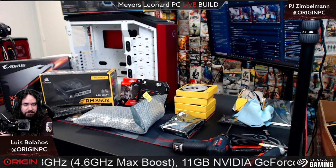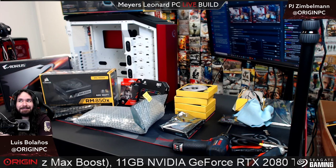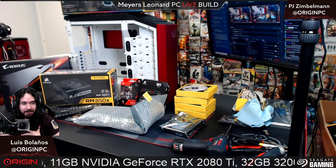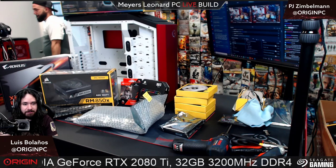One thing, the 3900 gets really hot. So the liquid cooling does a pretty good job of that. You can use a really good heatsink, but for that, I would probably go with liquid cooling. Personally, as a point of reference, I'm using the i7-9700K with the heatsink. And it works for me, but I know that if I did go with liquid cooling, I could probably get a little bit better performance with it.